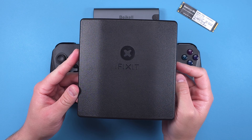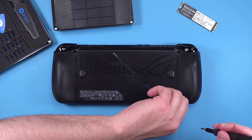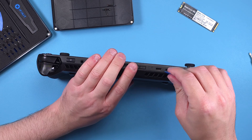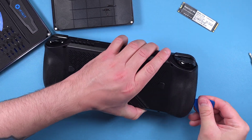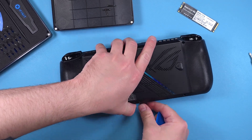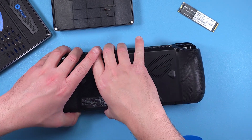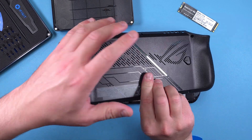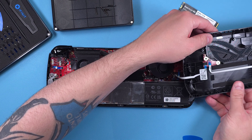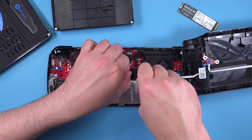I'm going to be using my iFixit kit — I'll link that in the description but you don't need it. Use the Phillips Zero screw bit to take the six back screws off, but note that the middle bottom screw does not come out — just loosen it as much as you can. Once you've fully removed the other five screws, use a pick to get in from the top where the triggers are and slowly separate the back shell. Be careful and go slowly to pop it off — there's a ribbon cable attached to the macro buttons on the back shell and pulling too hard could snap it. I didn't bother detaching the ribbon cable; I just made sure to be careful and had the back shell resting on the side, but feel free to detach it if you feel safer doing that.